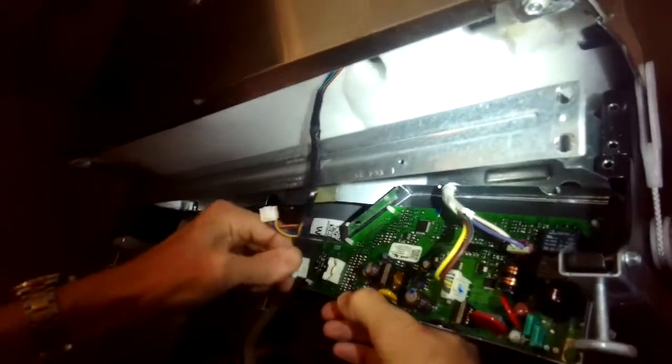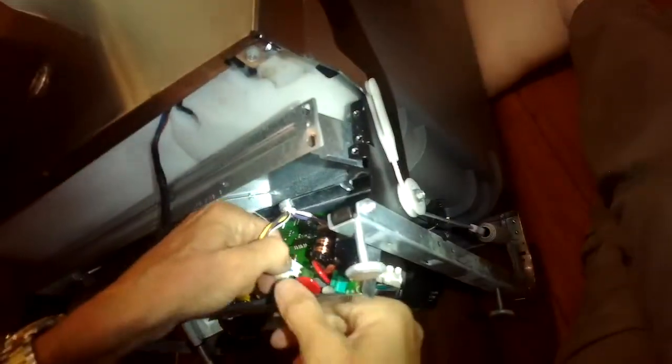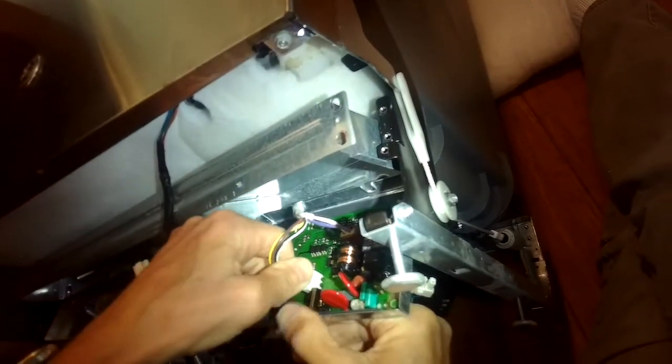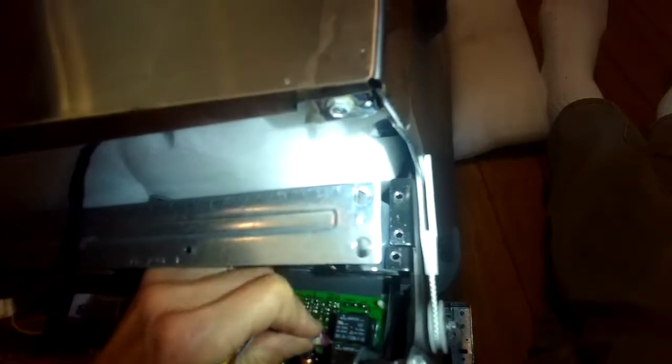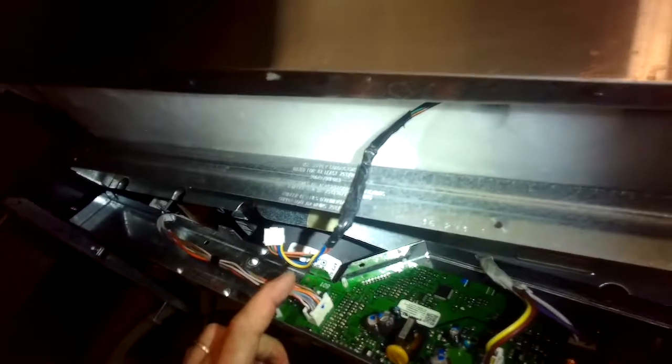Customers are not too happy with these GE dishwashers because they're inexpensive but they just don't last very long — components fail pretty quickly within two or three years. To replace the controller, pull out all the modular jacks and then gently pry out the old circuit board; there are little pins that hold it in. Pop in the new one, put the jacks back in, close up the sheet metal cover, and reinstall it — you're all done. The controllers are about $80, and it's the controller that's failed about 15 to 20 percent of the time, which is the case with this particular dishwasher.